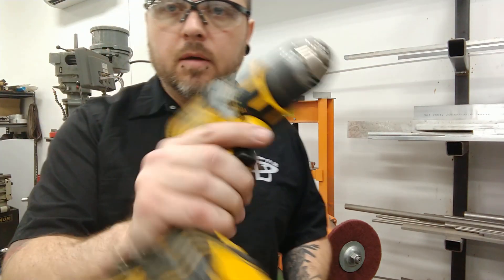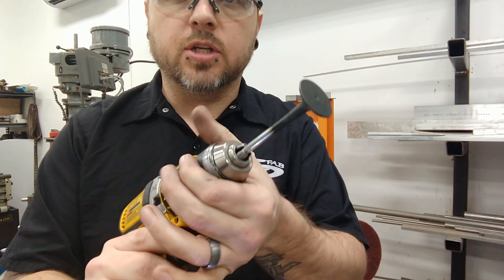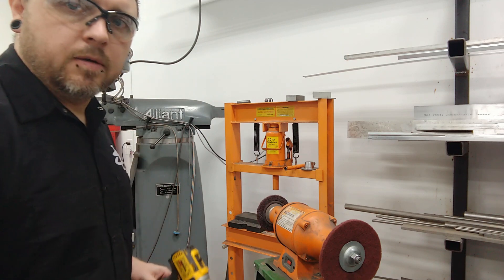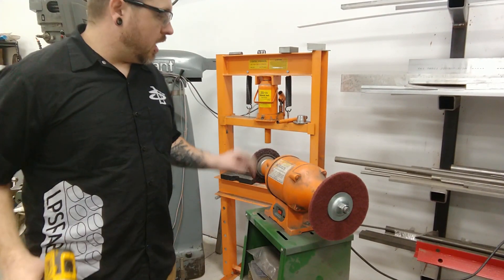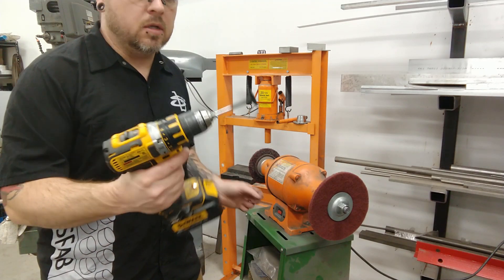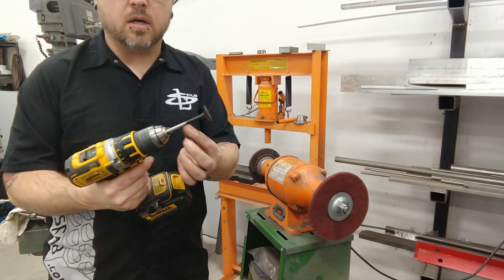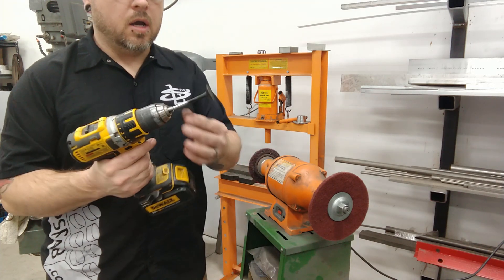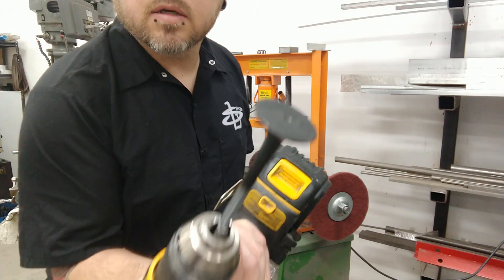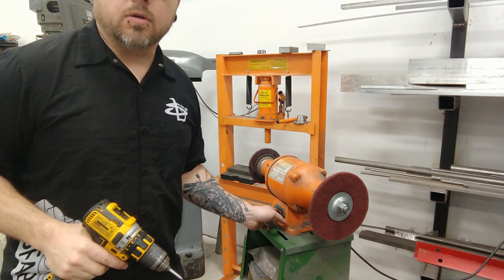Basically I just take a hand drill and grab a valve in the chuck gently, don't go too crazy with it. And then I got a couple of buffing wheel compounds over here. I've got kind of a medium grit and then a super fine grit. All I'm going to do is spin this in the drill, being careful not to hit the ground surface that the guide rides on and also be careful not to hit the seat too hard. I'm just going to spin this and hit it on both of these wheels. The valve is starting out covered with carbon, and I'll just go through all these valves and clean them up.